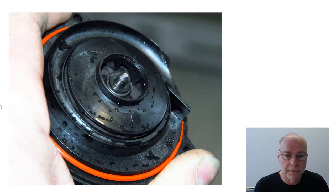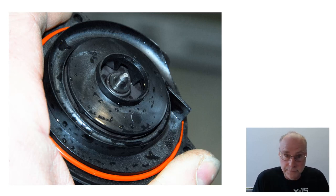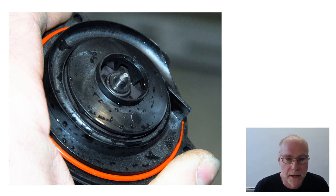So I pulled the end off to find it's got a very different impeller to the Johnson pump — a much more sophisticated impeller where water gets drawn in through the eye of the impeller and then thrown out at the edges. You can see it's quite a good hydrodynamic shape, but it just didn't work. It didn't work when I had restrictions on the inlet and restrictions on the outlet. You're always going to get those restrictions when you've got heat exchangers that the water has to actually pass through.